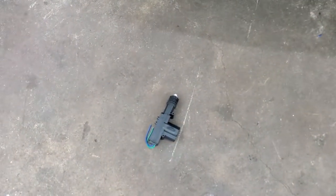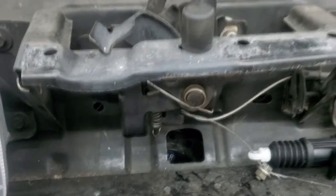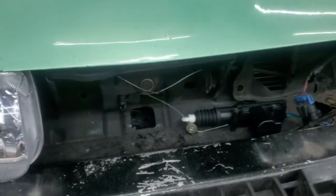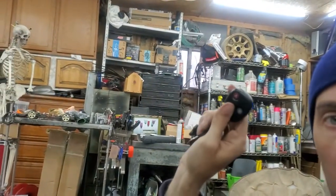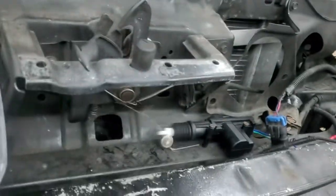That was a really quick job. It was definitely the motor that went bad — I've got the old one right here. I still had power going to it, I tested it. So this is how it works: the servo motor is mounted here, going up to the turn mechanism. When it engages, just like that — simple. That is how you make your hood remote pop open. It pulls and turns, so the hood opens with the button.